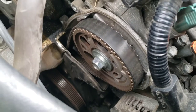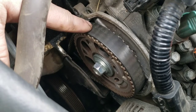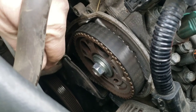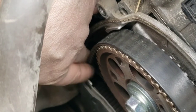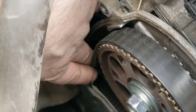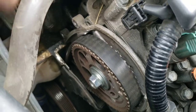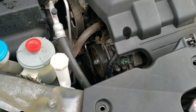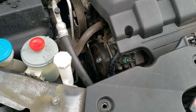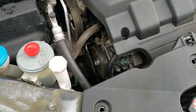I got the front cover off. I wanted to show this real quick — this belt doesn't see any cracks and feels real nice and soft and rubbery. But look at this — you see how much that is moving? That's a pretty loose timing belt. When they get loose enough, that's how they start skipping teeth. The reasons it would be loose are either it stretched, most likely, or you have a failed tensioner.